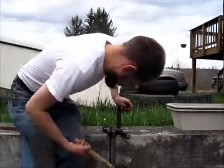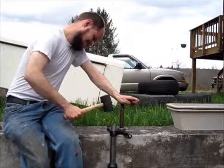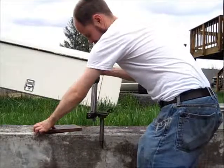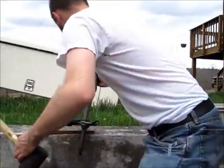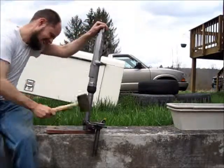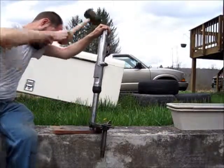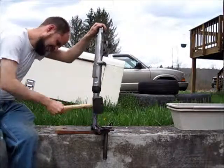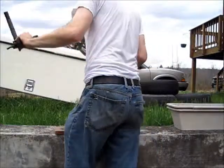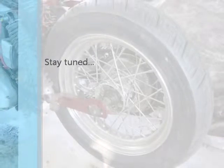And there you got it. Try not to scratch the lower part of the lower fork. There's one other way you can do this — put it down on a block like this, womp on the other side using a rubber mallet, of course. The metal one would ruin it. You've got to watch it — that thing can bounce back and hit you in the face and bloody your nose. And there you have it.